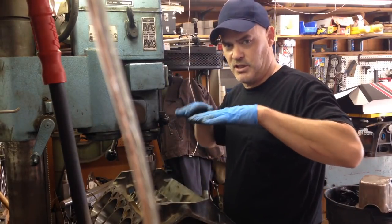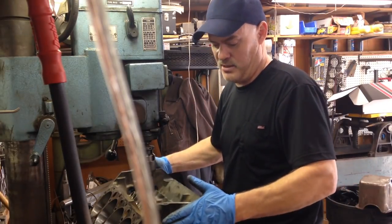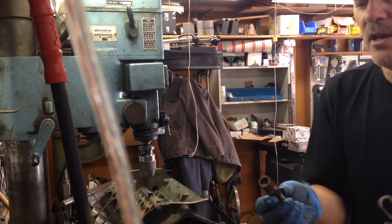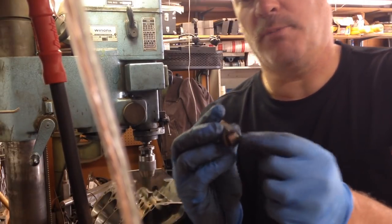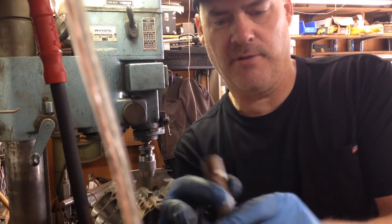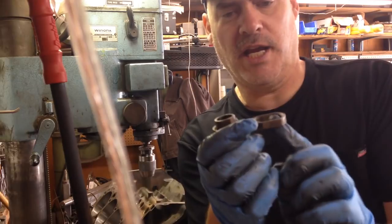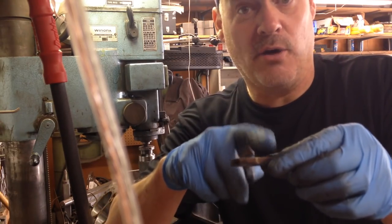Obviously we're using the machine because these holes have to be located correctly and it has to be square — the block has to be leveled. So let's get started. Basically the roller lifter has what they call a crow's foot or anti-rotation bracket. If you look at these — the roller lifter, it's a roller cam — this is an old used roller lifter. We're going to put new ones in this block. But the roller lifter has to stay in line with the cam lobe. They have these machined flats on the lifter, and each one of these sits over the lifters right on top here, and that's what keeps the lifter in line, or keeps it from rotating. Each one of these goes over a set of lifters.